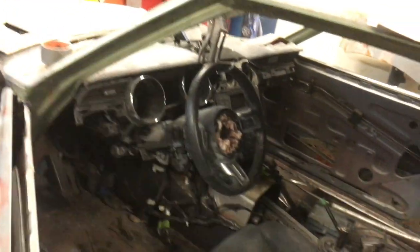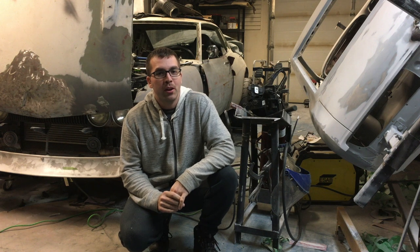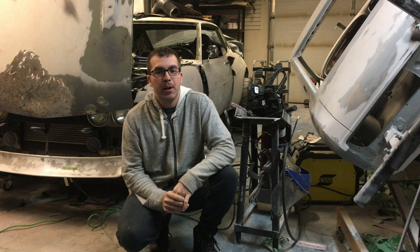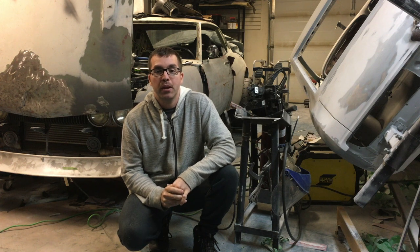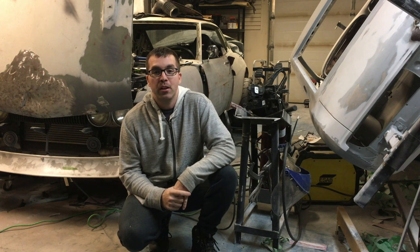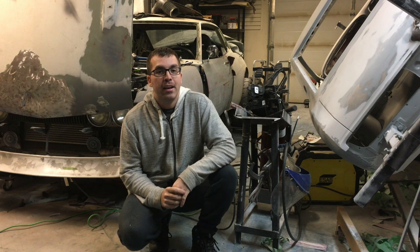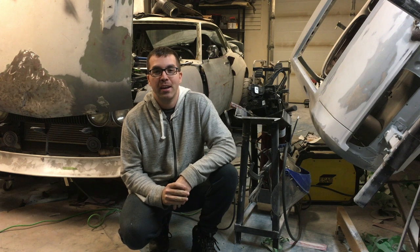That's one more look at the front of the car there. Well guys and girls, we didn't get this thing started today — we aren't getting spark at the spark plugs or the coils, but everything else seems to be functioning. We're going to get some specialized equipment to read the codes and get a little deeper into it; Tony wants to do some studying on it. On another note, I've got the steering wheel mocked up, and in the next video some neat things will be happening — lowering the seat on the frame, custom work with our Honda SIR seat, and hopefully getting the pedals done. I need to build the firewall before that, so stay tuned for next time on project Snake Charmer.